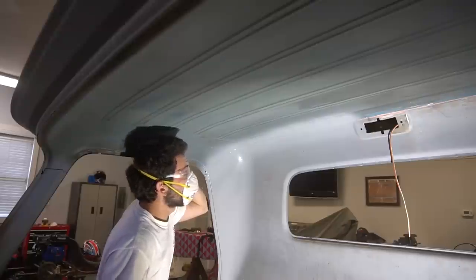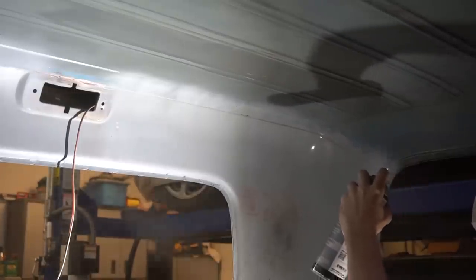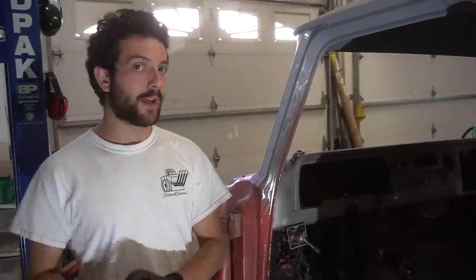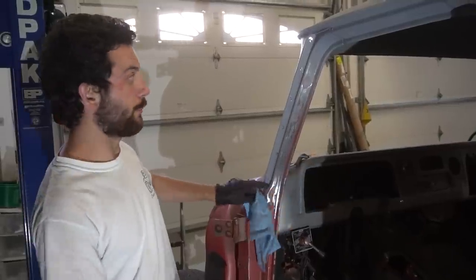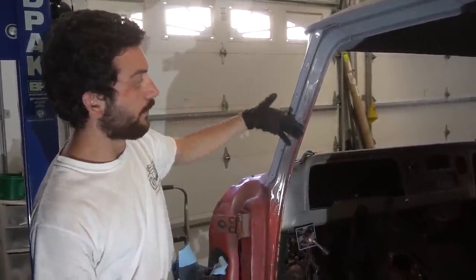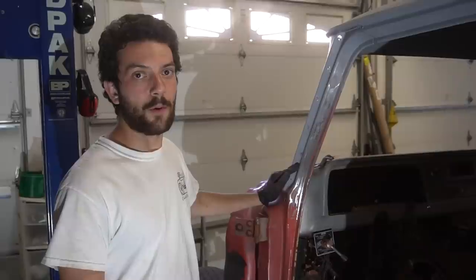It's not even at all. Lots of pinholes in it — I've got a lot more work to do. I pulled the old Cadillac out so I could do some painting over here. A few weeks ago I sandblasted underneath the old drip rail. I'm going to shave this drip rail — I'm not going to put it back because there was a lot of pitted rust I had to sandblast to get it all off. So now I just need to use some body filler. First I'm going to use my self-etching primer and prime this area right here, then use some body filler, fill it in, sand it down, repeat.